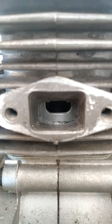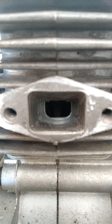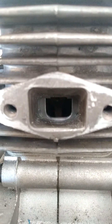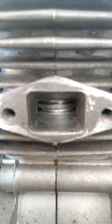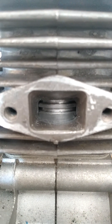But I don't want to remove too much material. In the real world, if I had known I was going to jack my cylinder, this window would have stopped a little sooner and I'd have left a little more skirt. No big deal. So that answers the question — at what height do you start your window? Right after BDC.